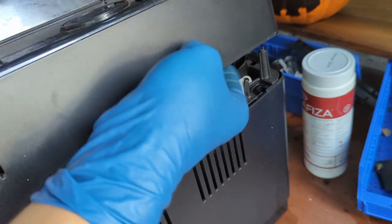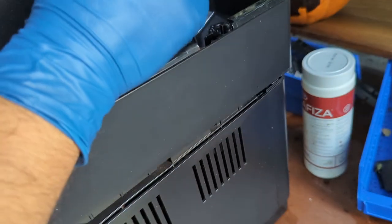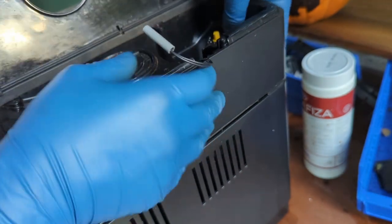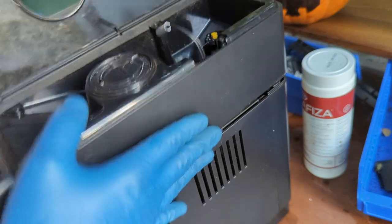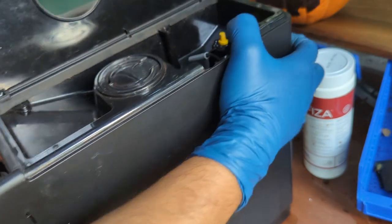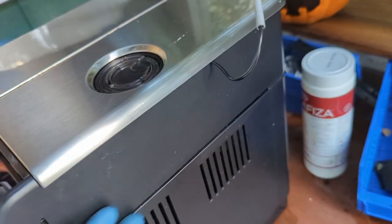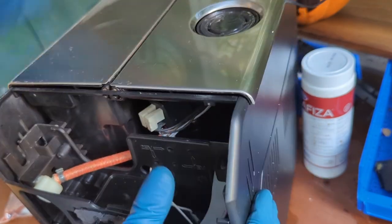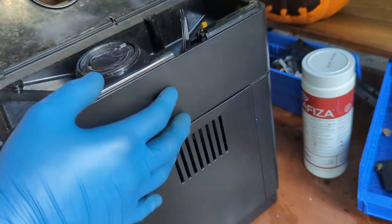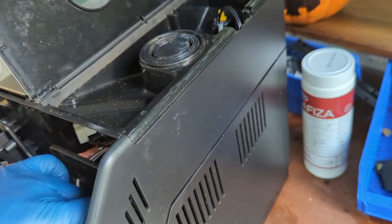Again, cable through the machine, all the way up. Grab it through here. Make sure you have this hopper cover open, so that way you can see that you're placing the cover on top of the grinder and then not forcing it, but just slowly placing it into the machine. You will kind of feel it when it's in position and see everything click into place. If there's something that is not letting it go through, it's usually because there's something preventing it. You can always check and peek through here if there's anything that you're missing. This feels secure, it's just missing a few screws, and the spring is what is actually pushing this cover a little bit up. So yeah, we're good to go.